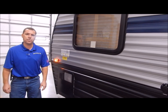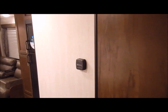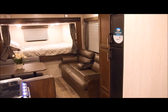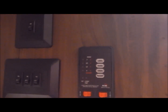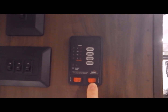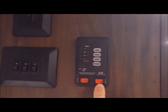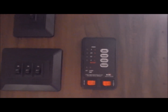That concludes the outside — now we'll move to the inside. You have your queen mattress in the front along with a wardrobe and a bunk above that, your bathroom on the driver's side, a refrigerator, pantry, sofa, dinette, another bed in the back, and your kitchen immediately to the left. Right inside the door on the end of the overhead cabinet is where your interior and exterior light switches are, along with your monitor panel. For dry camping: fill your fresh water tank, turn on your water pump switch on the right, and as you open the faucet it will maintain pressure from your water source. Your gas switch for the water heater is on the left, and this is also where you check your gray, black, fresh water, and battery levels.